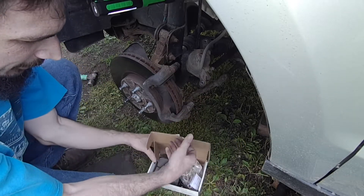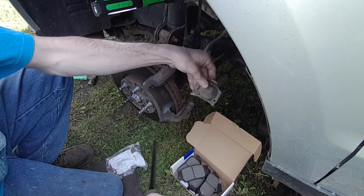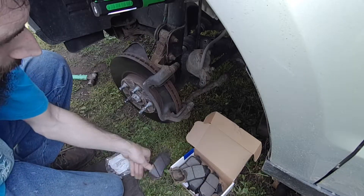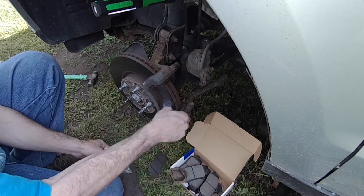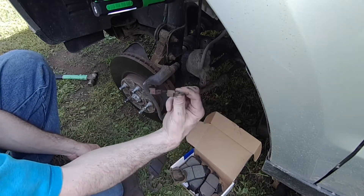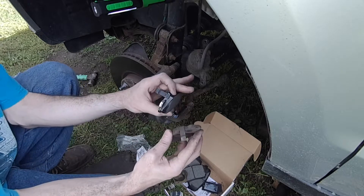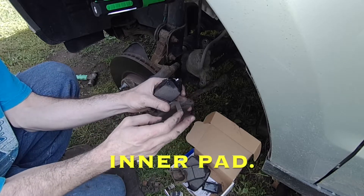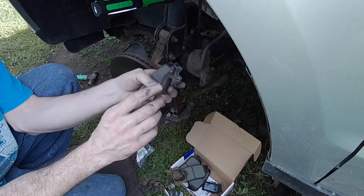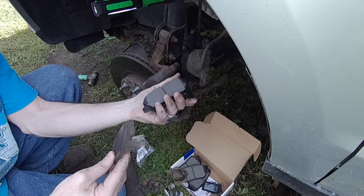So we have our new pads — Wagner pads. You'll want to reinstall the wear plate back on the inner pad, so just pay attention to that. And then these clips — you have new ones, so use the new clips and just change those out. I believe all the clips are the same. Now you can see on the old pad and on the new pad — this is on the rear pad — it's called a squealer, and what it does is ride on the braking surface when your pad is almost worn out. It lets you know that you need to replace your brake pads. That always goes on the inside — make sure you put it on the inside.